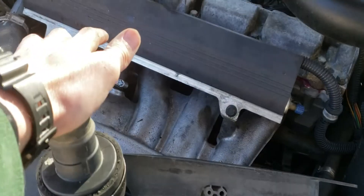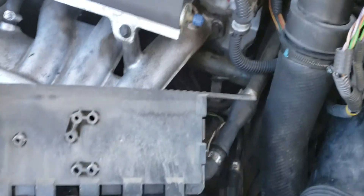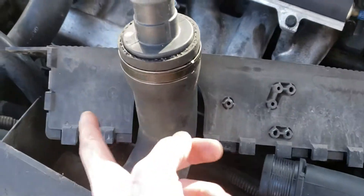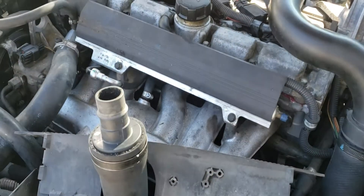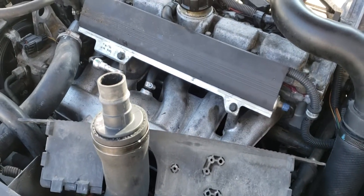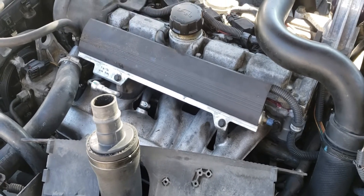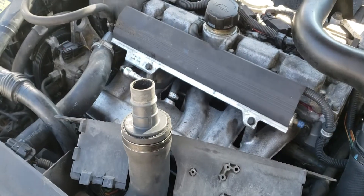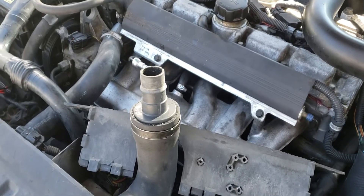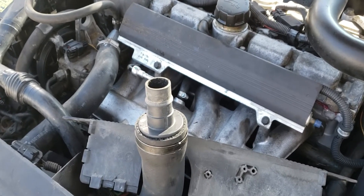I could try covering this and having somebody else start the car to see if it builds pressure, but I'm probably gonna flip this hose over and continue checking for leaks. But this is how you check if your turbocharger is functioning — using a fogger, cigar, or however you want — you just put it in, start up your car, and you get a little bit of boost as soon as you start up. Look where the wastegate can open and that's it. If you like this video leave a like, don't forget to subscribe — I do all kinds of crazy stuff and little life hacks. Thanks for watching and I'll see you in the next one.